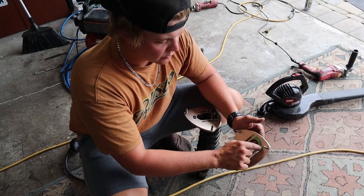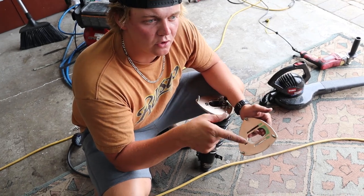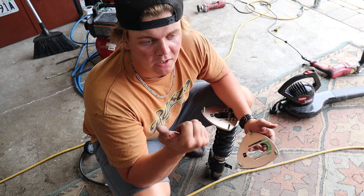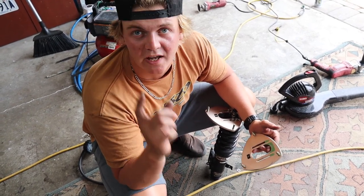We didn't completely go all the way to the outside because he has slotted lowers, slotted coilovers, and now slotted top hats. So that's lower control arm camber, knuckle camber, and also upper control arm camber, which is gonna help with axle bind.